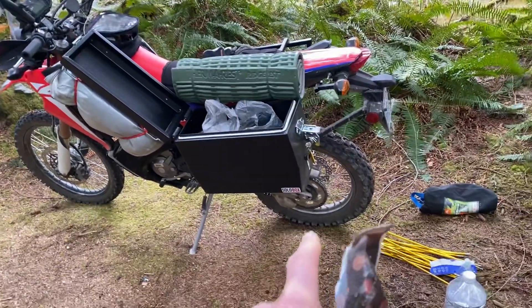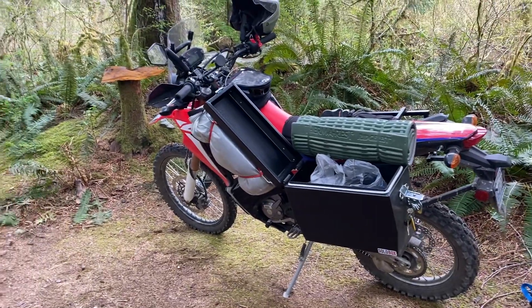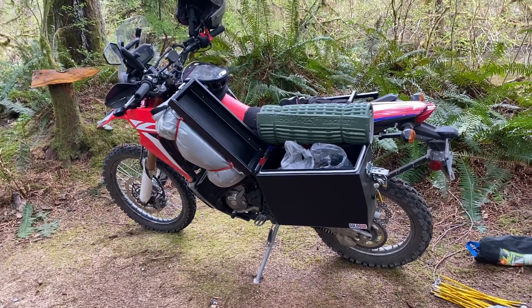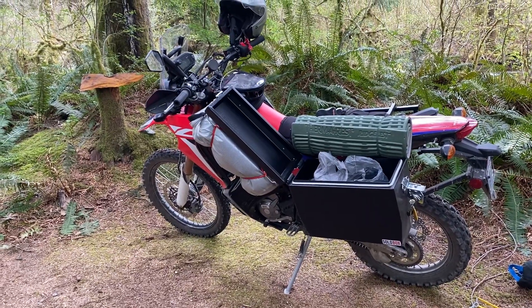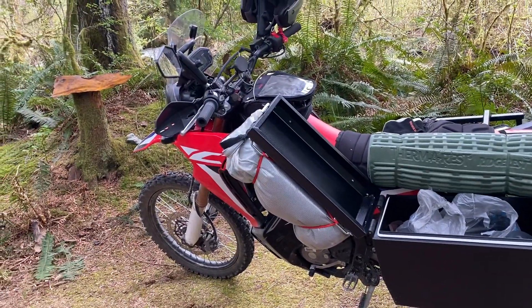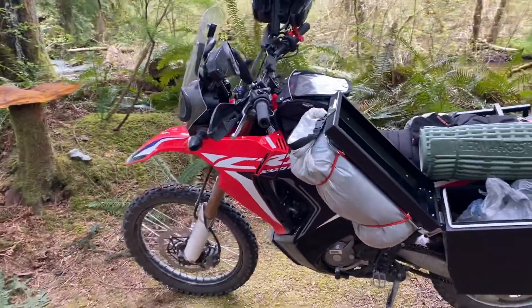The only modification I made really was adding two teeth to the rear sprocket, which you probably want to do anyway. I'm only about a 150-pound rider though, so somebody getting up into the 200-pound range might find that maybe it's not enough. They did just start making this bike in a 300cc version, which I really had hoped to buy, but those bikes still aren't in dealerships here in North America. I'm glad I grabbed the last 250 while I could. Actually, thinking about it, maybe I'm better off having bought the 250 — one of the changes they made with the new 300 is it's got weights in the end of the bars, which tells me there might be a little bit more vibration, a bigger piston, more mass going up and down, so it's probably going to be a little more buzzy. Maybe I've already got the better of the two bikes. I own this one now so it's probably a little bit late to change my mind.